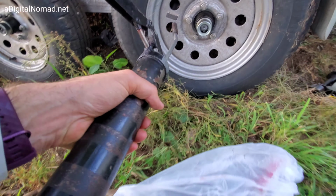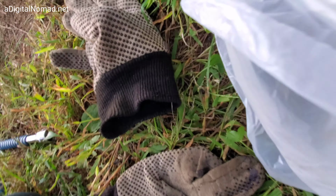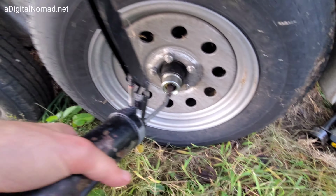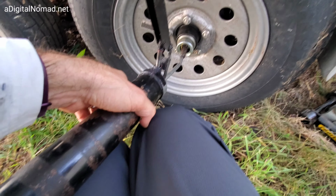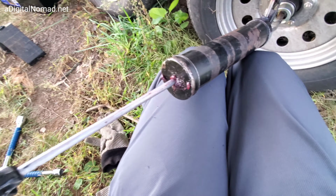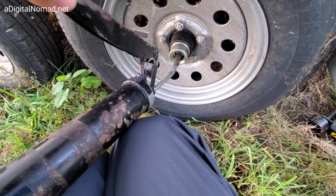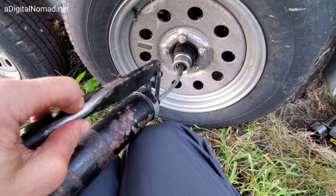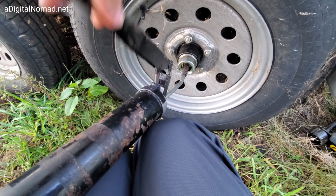You've got this open. Now you want to start pumping again. Go to your fitting. You've got to go to a fitting right away. Oh, let's get this. Sorry, there's a little bit of grass on there. Go to your fitting and get it started. It will take a few pumps. It won't be normal until after a few pumps. But then after a few pumps, you're ready to go, and you can twist this and push it in all the way, because it'll be loaded with the pressure it needs already. It's already going. Look, see, it's already preloaded. I can feel it. Oh, no, it's still a little bit air bubbles. See, I gotta sometimes do these few air bubbles.